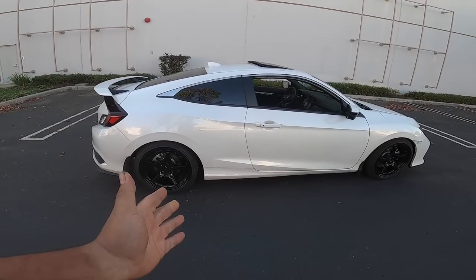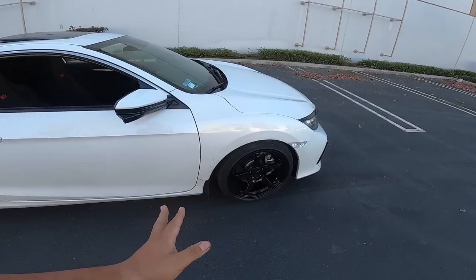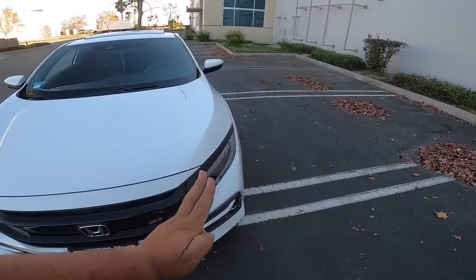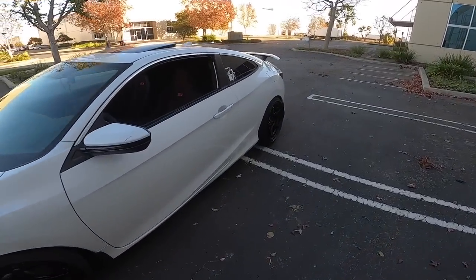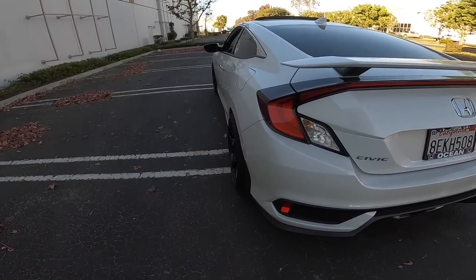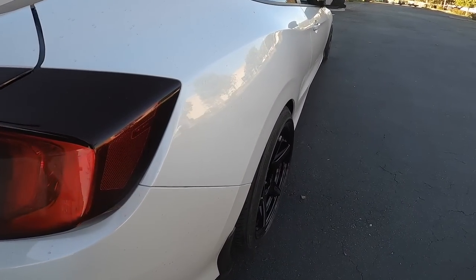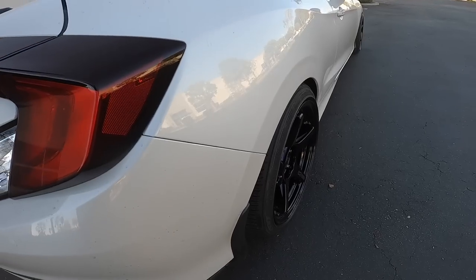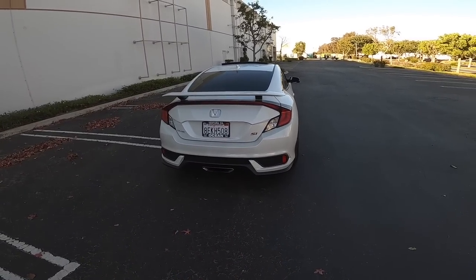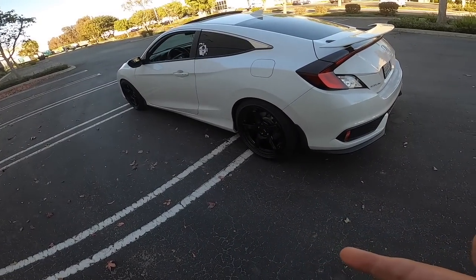A lot of people were saying you don't need a rear camber kit on this car when you're lowered on Eibach springs or D2 — that they've been running it for tens of thousands of miles. But you will get uneven camber wear. This side's a little more negative cambered than the other side — it's just how my camber was when I got the alignment done after putting on the springs. I'm gonna have them tweak the stock alignment so it's even, and eventually I'll probably end up getting Eibach rear camber arms.